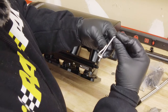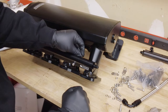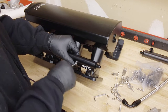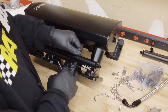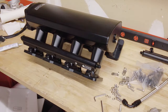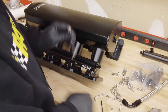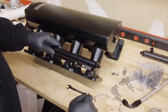I need one with a ball head on it — a four millimeter with a ball head — but I might be able to squeeze that in. We can go ahead and kind of spin this thing in a little bit. These nuts are going to be on a relatively flat plane of existence. Go ahead and throw that lock washer on there. I'd still prefer a washer stack-up — that's just the inner nerd in me. The nut size is 10 millimeter. Go ahead and get this snugged down — we'll tighten it up later. And rinse and repeat — this is where everything goes into fast forward mode.